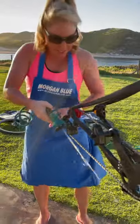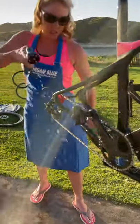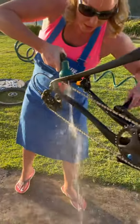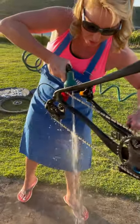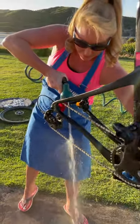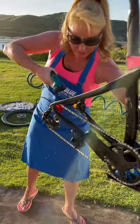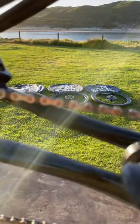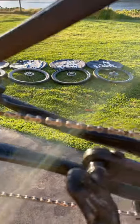Then the last thing you really want to do is get back onto your jet and get down into those links — you can come from this side — to really get that dirt out of the middle of the links of the chain. Now if you have a good look at that, that chain without any scrubbing or hard effort, just with that Morgan Blue chain cleaner, has come up a treat — like new.